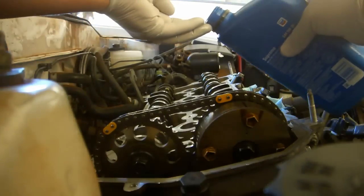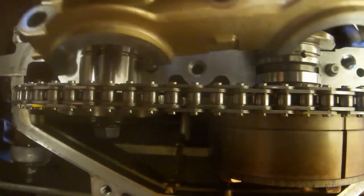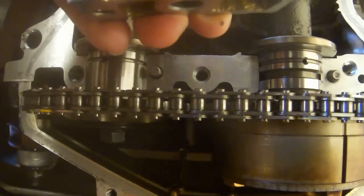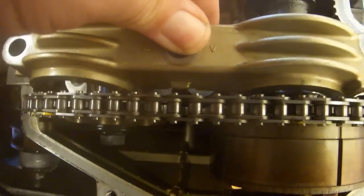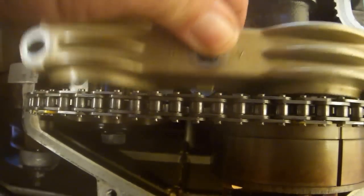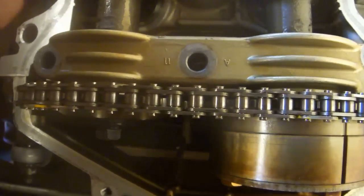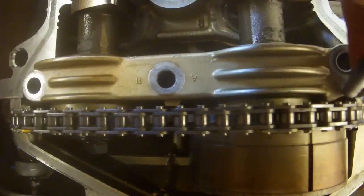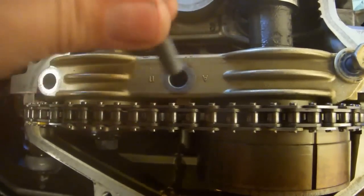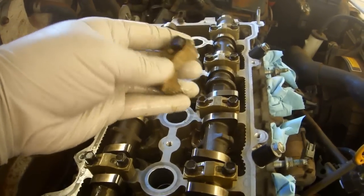Put on some gloves and make sure that all of the bearings and journals have lubrication. Install the number 1 journal bearing cap, making certain that the holes in the bearing cap line up with the pins on the head. Don't try to seat it all the way down just yet though, because it won't seat properly until we tighten down the middle bearing cap bolts. Put the bolts into the bearing cap, but don't try to screw them in at this point. Lubricate and install the remaining bearing caps.